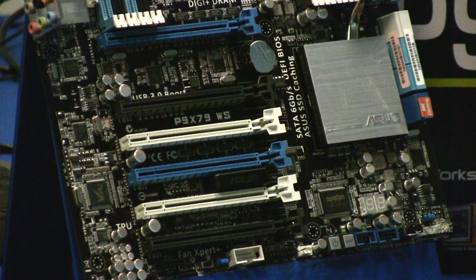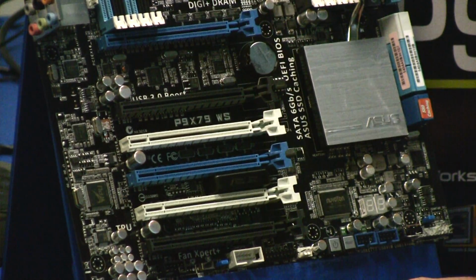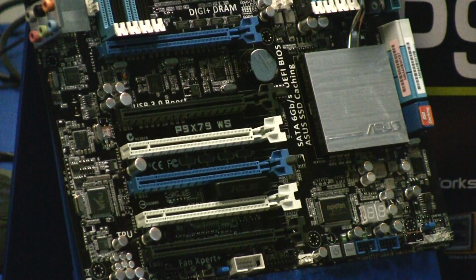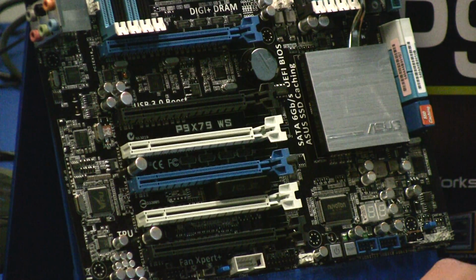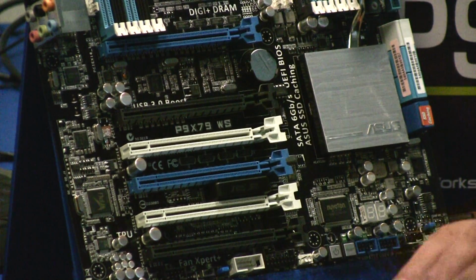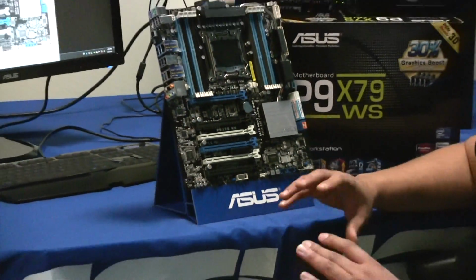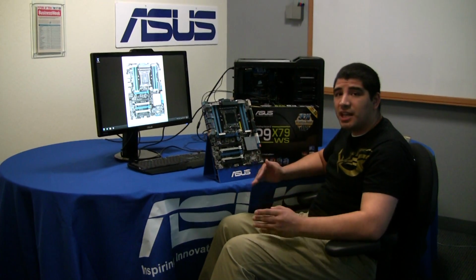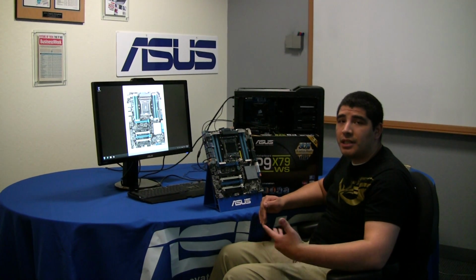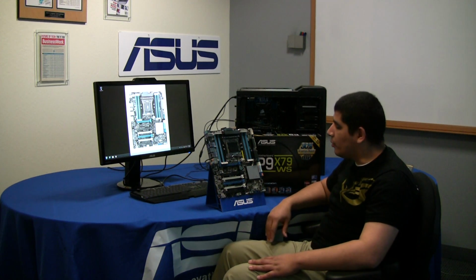So WS, that's one of the key parameters, in that these PCI slots, while they offer a lot of expandability, we're also doing a lot of back-end to do more validation. Higher-end controller cards on the market, like high-end RAID controllers and specialized network controllers, sometimes have their own specific option ROMs, which can sometimes have difficulties with standard BIOSes or even our standard UEFIs in terms of initializing and supporting those devices. Our WS team takes more time to validate more of these devices to ensure a higher level of functionality, interoperability, and ultimately better compatibility so that you can use these devices and have them work correctly.